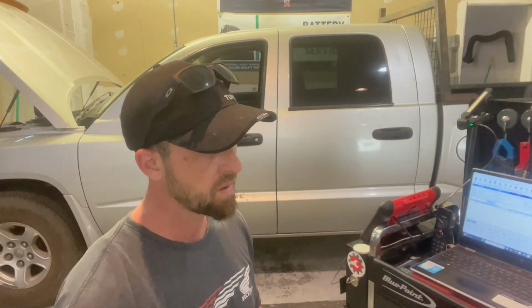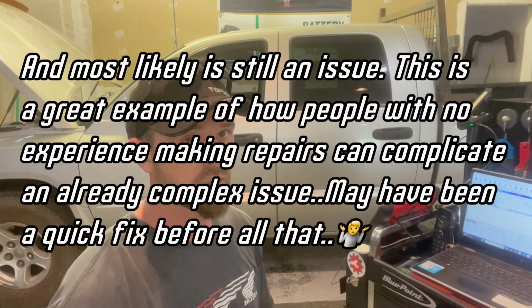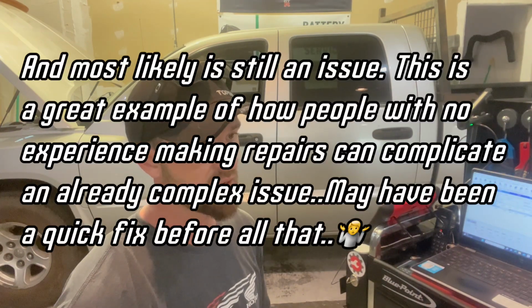We tested the clutch, and that's the key point that I want you guys to take from this video: don't go down these rabbit holes. Yeah, there's a pressure code, which very well could disable the clutch, but we were getting 12 volts at that clutch, and it's not operating. So if it's not operating, the compressor is not working. Like I was saying, that clutch engages, and it causes that pulley to now spin the compressor, which creates the pressure on the high side.